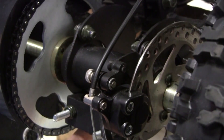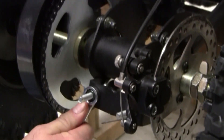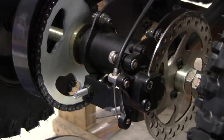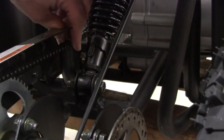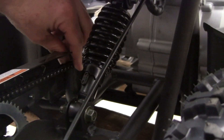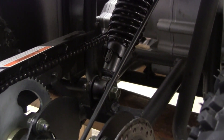We've finished loosening these four bolts and nuts. It does not take much. I'm going to go about a quarter of a turn on both of them at the same amount, because that will keep the axle level. That is a much better slack in the chain — it's not as tight. I'm just going to go just a tad bit more, about maybe a sixteenth of a turn.